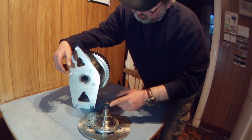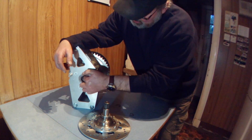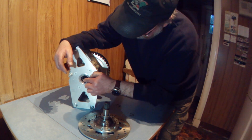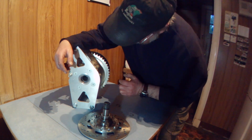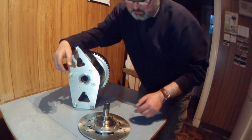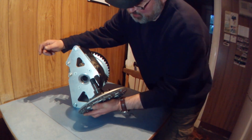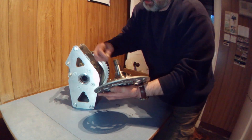When installing this, if you apply plenty of grease inside the splines, the splined area inside the differential itself, and between this outer bearing and the end of the differential itself, that will save any galling of the shaft. If it did run dry, it would possibly gall and seize in there — highly unlikely given the amount of grease you're going to be pumping in anyway.